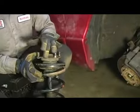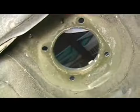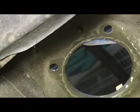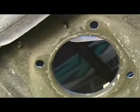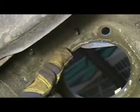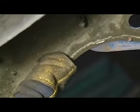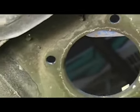Now on the body of the vehicle, there will be a corrosion mark which will indicate where this part goes. As you can see, we have a corrosion mark from where our upper mount seats to the body of the vehicle. What we're looking for is an indicator tab that'll let us know the proper alignment for installing our new strut. As you can see, there's a little dimple right here — that's what we're looking for. There'll be a corresponding dimple on the mount, and we're going to want to make sure to line those two up when we install it on the vehicle.